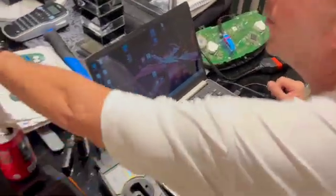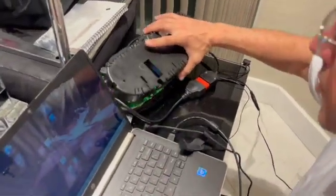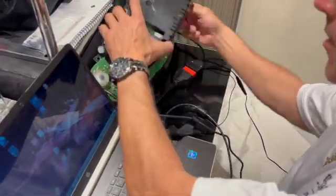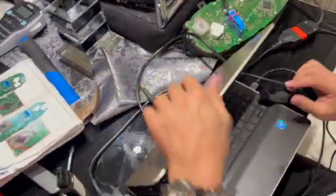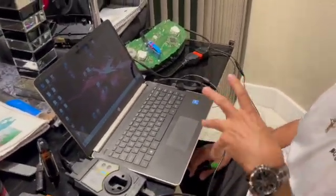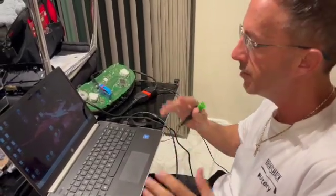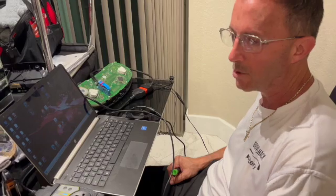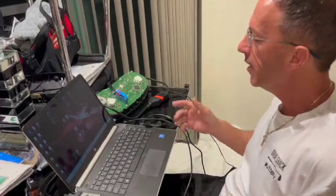I got this from the junkyard. There were four screws — I unscrewed them — and then there's a flap here and a flap here. Just unflap it so you don't break it. If you're taking the cluster out of a Jetta, be careful. There's a video out there that shows how to take the whole dash apart because it's very delicate. I've seen so many people crack it, so just be real delicate. I've got tools that just unflap it — there's a good video out there you can look up.